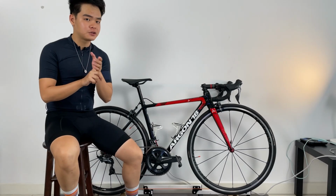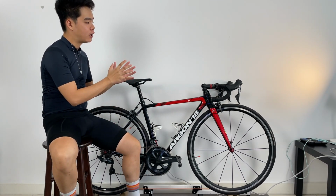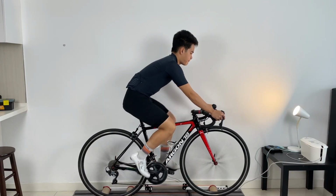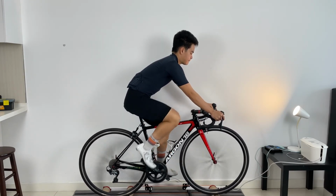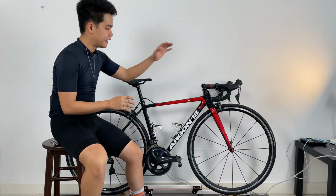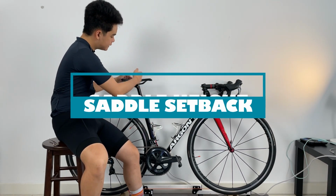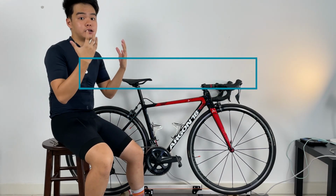This is the first episode of a 3-episode series on how to do a bike fit DIY at home. Now, this DIY bike fit is done purely based on your phone and your camera to record yourself, and of course your own eye to see the angles of where you should roughly be. So in these 3 episodes, we will be going over the 3 contact points on a bicycle, which are the hand, saddle and the feet. And in today's video, we'll be going over the saddle. We'll be looking at how to adjust the saddle height, saddle setback and the saddle tilt, and where is roughly the correct range that you should be in.